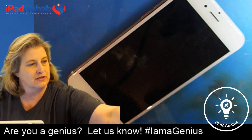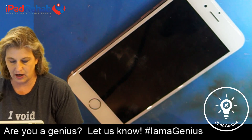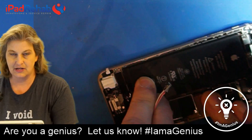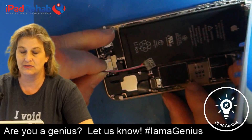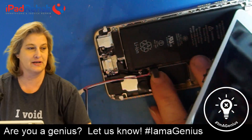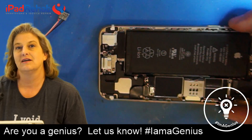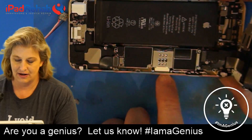We're going to start by plugging in a DC power supply to find out what category of dead this is and see if it matches a common signature failure point. Phones tend to fail in signature ways — they have weak spots. Connecting the DC power supply, it shows really high current consumption right out of the gate, which tells me there is a short circuit, likely on VCC main.